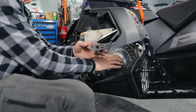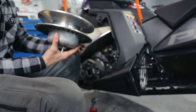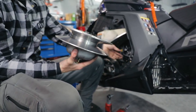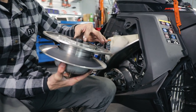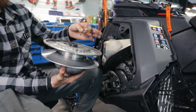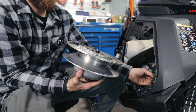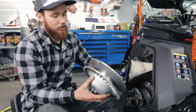You don't want to lose any of these washers or your spacer, so keep that all together. Then pull your secondary clutch off. When you pull this off, be really careful — all of these spacers that align your clutch like to stick on the back. As soon as you pull it off, roll it up and make sure you don't have anything stuck there. If you do, just slide it back on the shaft.